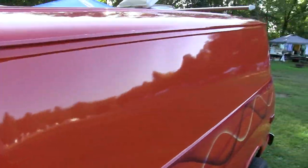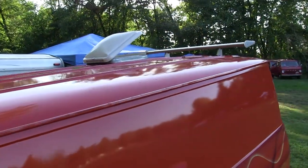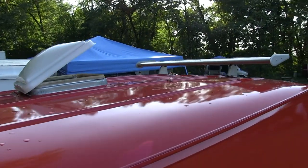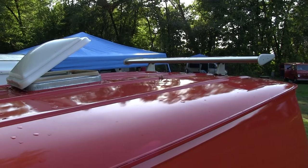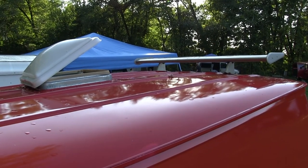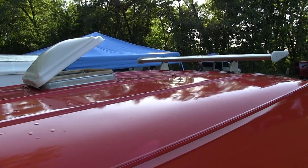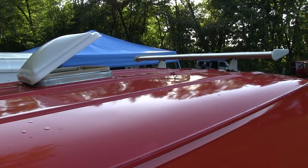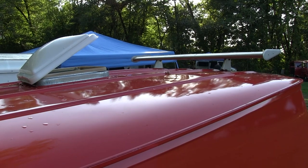You got a roof fan on the back? Yeah, it's got a fan in there that blows in or out. Because in these vans, you don't really want the fan sucking the hot air out because it draws the fumes out of the engine compartment in there. So if you have it blowing in, you can get the air and the fumes kind of pushes it out.